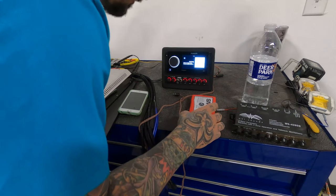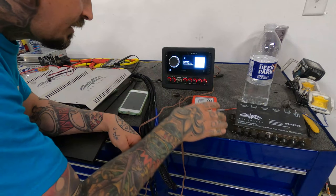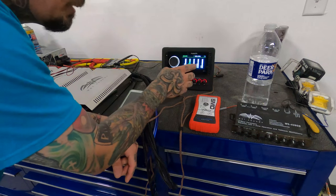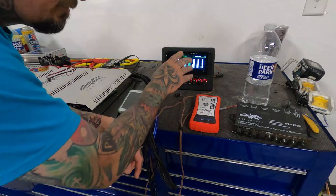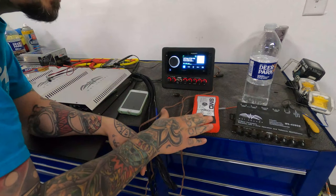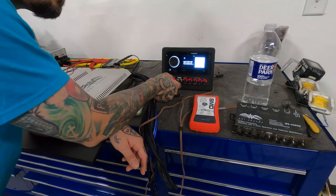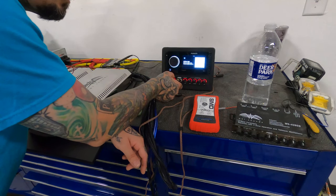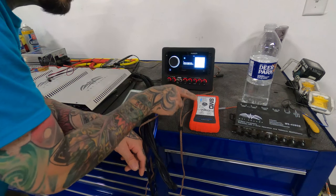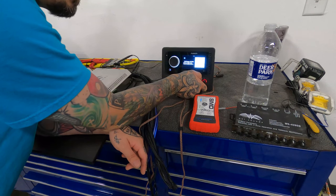Back and educated. So what we found is that this EQ — everything's rubbed off it, which is why we couldn't tell what it was. It's an older EQ, so I just didn't know what it was. To go back: we have our tower speakers coming out of the radio; we know that at full volume it's clean signal. Then we're running that into our EQ. Coming out of the equalizer, we have a volume control — that's the microphone volume. As we turn this one up, we'll see we have signal at 1K. As long as he doesn't go beast mode and turn all the equalizers to full tilt — we'll just measure worst case scenario — it looks like if he runs the bass EQ all the way up, it'll mildly go into distortion. So we're going to tell him not to play with that. That's a speaker destroyer.